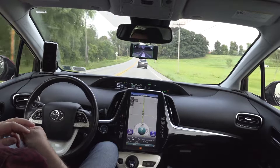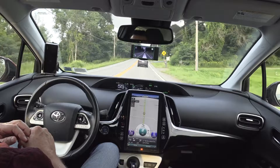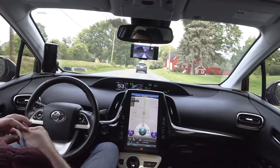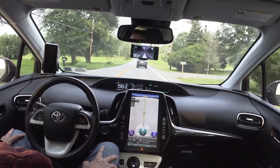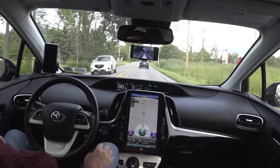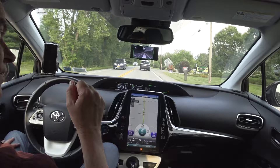I currently have laneless disabled. Laneless is a new mode where an AI model can run without using the lane lines, or doesn't rely on them as much. They're still working some of the kinks out — it still tends to hug a little bit on left and right curves. But the current model really does a really great job.